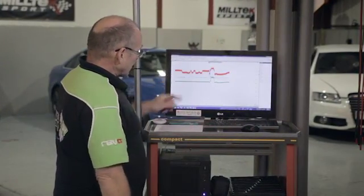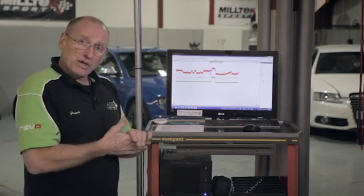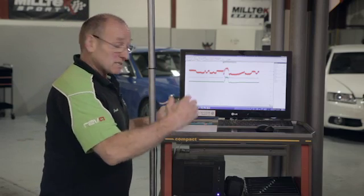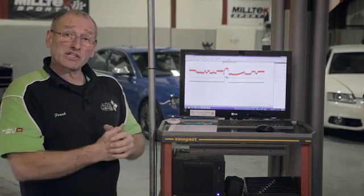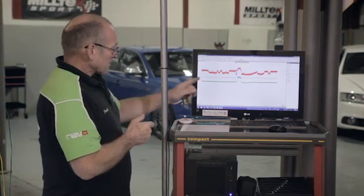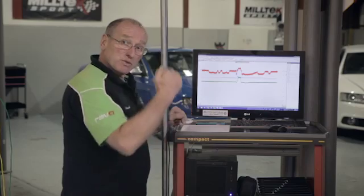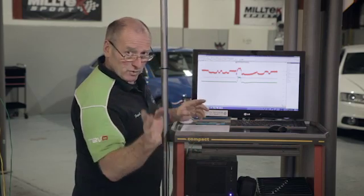I'm going to capture that. Notice how quick the recovery is and it doesn't have the over-swing which zirconia sensors do — it corrects within one event back to lambda one. These sensors are introduced because of very lean ratios with modern combustion principles, and they are now very commonplace in both diesel and petrol vehicles. You can see that without applying a throttle, the voltage remains between the 2.8 and 2.2 reference. Green is current — we'll come back to that in a minute.